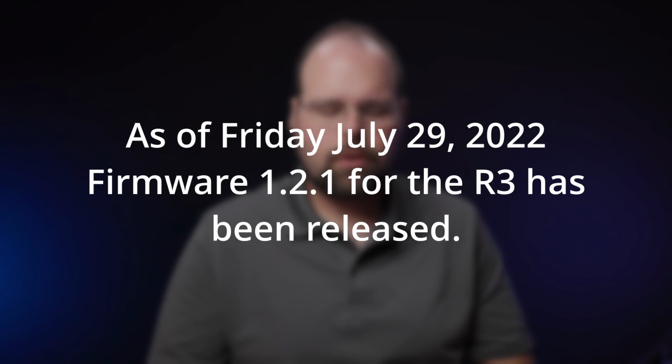As things stand, as I'm recording this on Thursday the 28th, the firmware 1.2 for the R3 still hasn't been put back up. I'm currently not recommending that anybody who's using an R3 upgrade to firmware 1.2 until it's reposted, and it will then probably be firmware 1.2.1. But this kind of thing really needs to be addressed internally at Canon and dealt with, that we should not have these kinds of problems where firmwares get pulled. This is also why I'm not a big fan of upgrading firmwares the week that a firmware is introduced, especially in the case of the R3, a firmware with as many new features and changes as they added. There's just too much room for bugs.